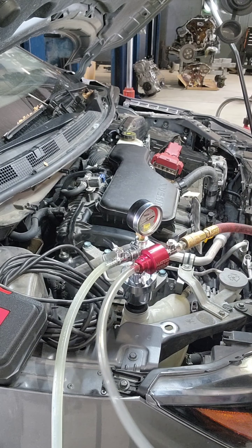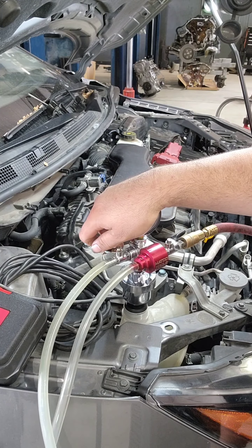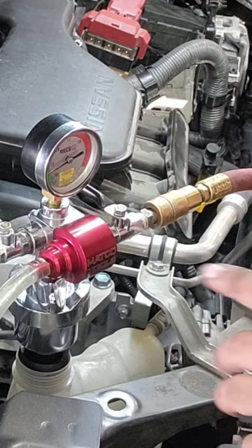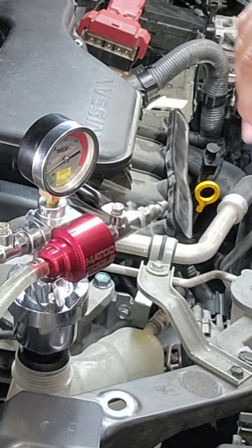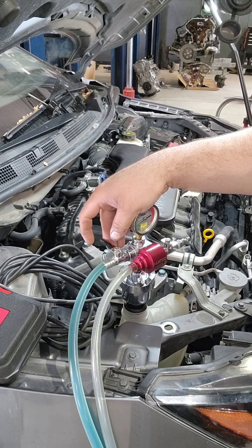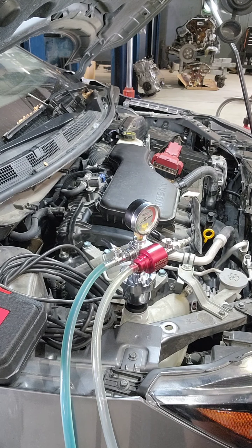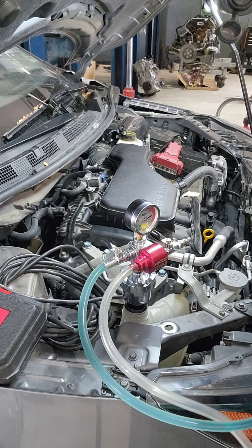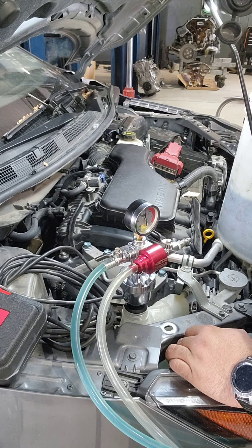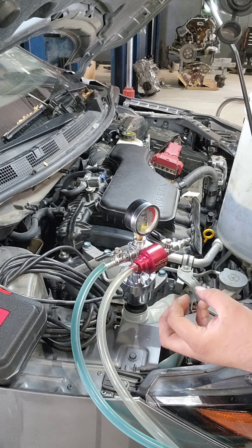Got my pulling vac right here. Get rid of the air pocket that's in the line — crack it. Now close off the air, let it sit for a minute, make sure it's only vacuumed, then disconnect that. Now we open this valve and let the vacuum take over. I like to keep the jug up with this — if not, gravity takes over and it won't fully fill the system.